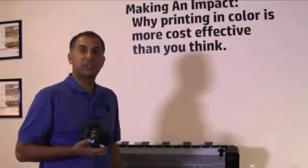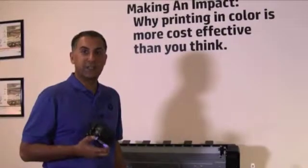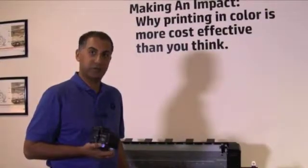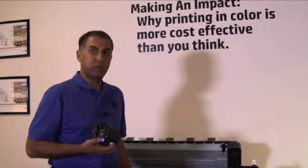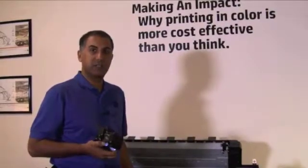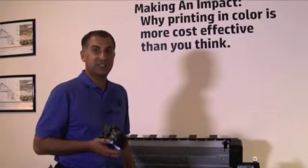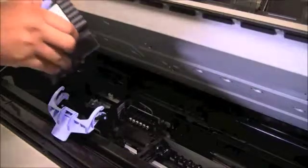You cannot insert a new printhead successfully if a connected ink cartridge does not have enough ink to complete the printhead replacement process. In this case, you should replace the ink cartridge before inserting the new printhead. You can always use the old cartridge later if it still contains some ink. Insert the new printhead slowly and vertically straight down.